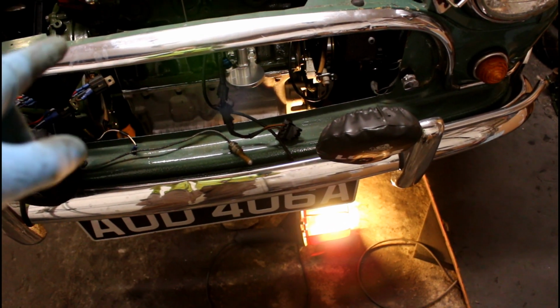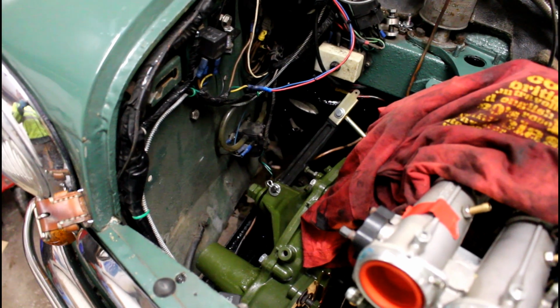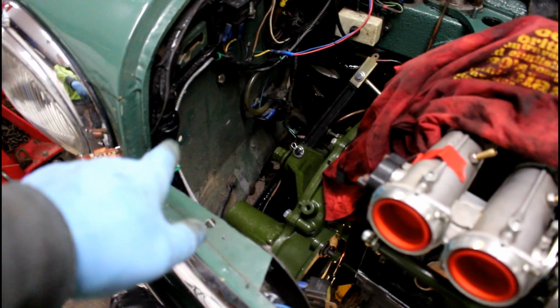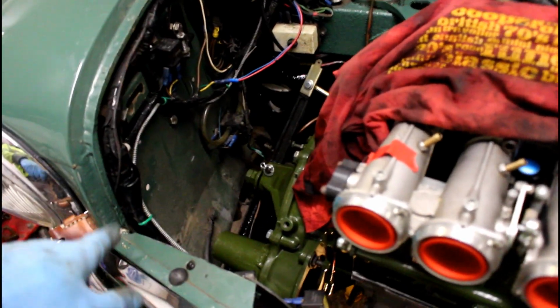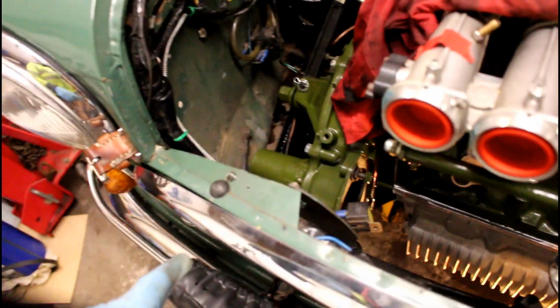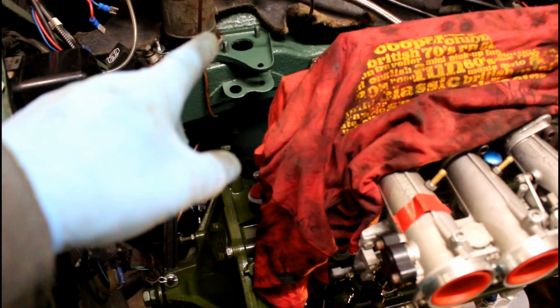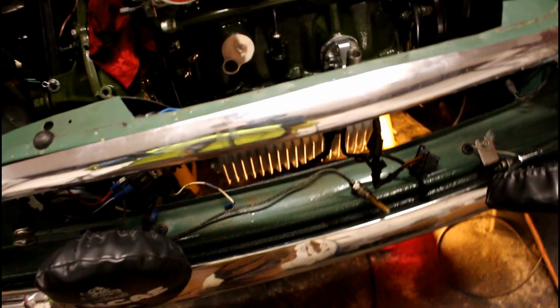I don't have the oil transfer pipe, because it was broken and I've ordered a fresh one. So all the stuff down this side of the engine bay has got to go back in. There's the air horns, the compressor, the wiring for that, the oil pressure pipe has to come down through that way, and then there's the big elephant's trunk that goes down over there, and obviously down the back there's the clutch slave to go in there, clutch cylinders to go in, the pipes. I'm probably going to start off, after I've done the starter motor and the alternator, with the exhaust down the back, because I think it'd be best to put that in before I put the pot joints in, and then go from there.